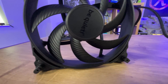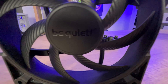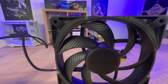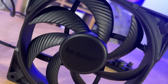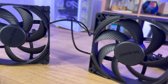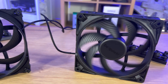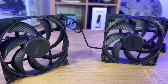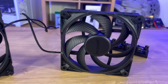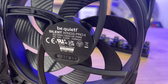The main negative with the Pro is the switch location — when we did our testing, you have to remove it from the radiator, unscrew it all, and change the switch between medium, high, and ultra setting. I would have preferred the switch on either the cable itself or on the edge of the fan where you could reach into your case and flick it. That said, once you've put it in the machine and set it, you're probably not going to change it again unless you like to tinker. Otherwise, I must admit you've got something for everyone — high performance, quietness, and unique fitting options.